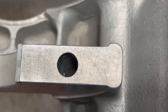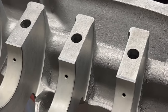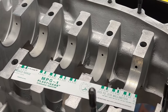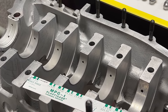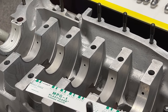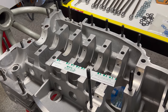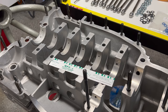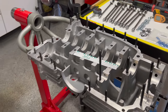Pressurized oil makes its way down in there and squirts through into the bearings, and also through to our oil squirters that were installed by Ollies. We just want to make sure that with compressed air the galleries are clean, and running some brake cleaner through there is also not a bad idea. We want to be clean from here on out — that's pretty much going to be our last chance, so no more dust once we start fooling with bearings.